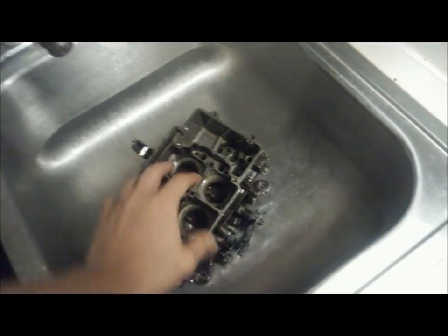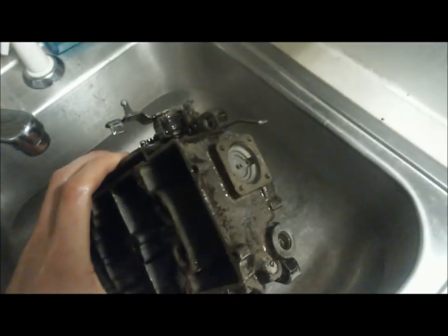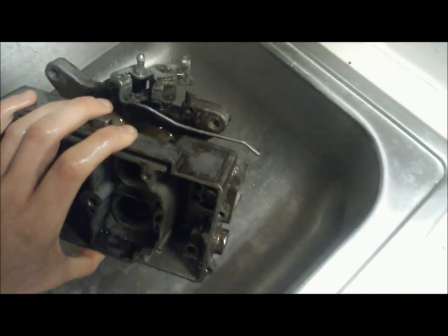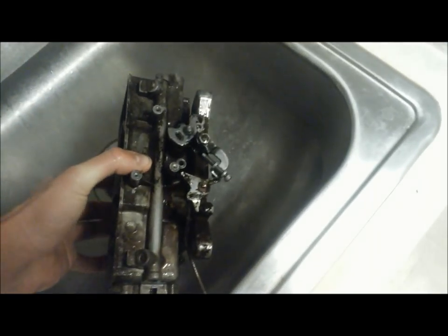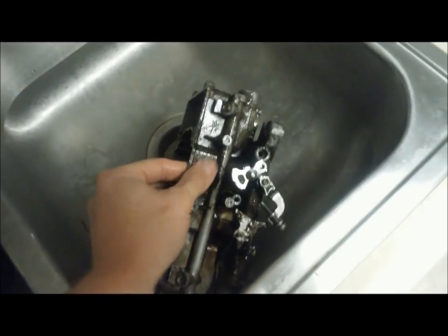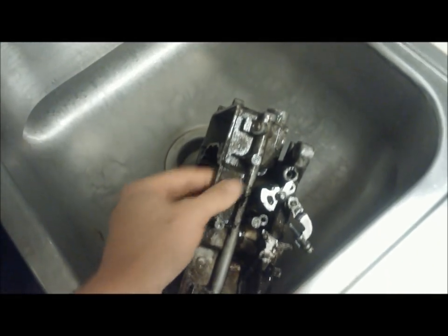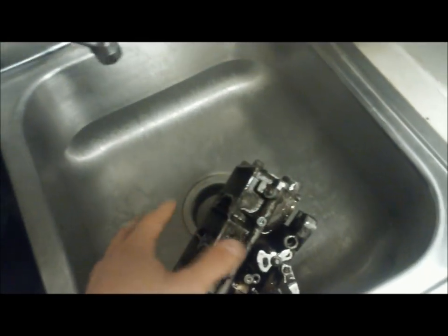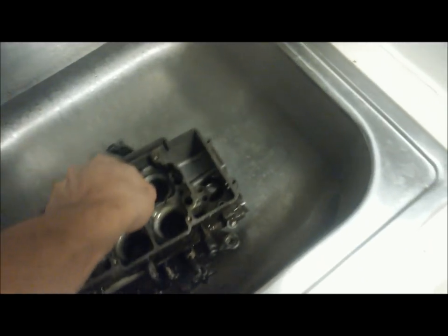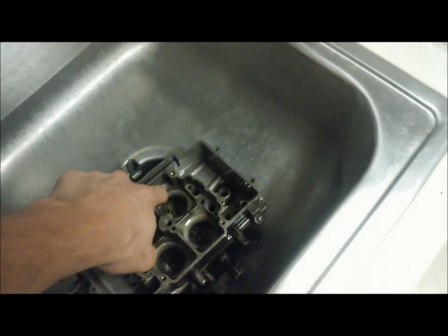The carburetor is actually cleaning up very well — all this was just caked with crud, so that's pretty impressive. It appears that if I just rub it with my finger it's coming right off. I think we can greatly accelerate this process by going around and scrubbing the carburetor with a toothbrush — look at all that. It's just taken that carbon right off the venturis. That's impressive, and that's only after 15 hours with a 50-50 solution.